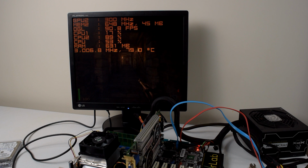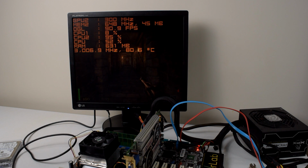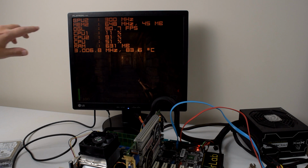And the way the Pentium 4 on the socket 478 behaves is it won't reduce the clock speed. It will slow down in terms of performance. It will basically just take a break. The temperatures will go down and then it'll start running again. And then it'll overheat, and then it'll take a break again. Now, those breaks we can't really see or measure, but we can definitely notice them in the performance.